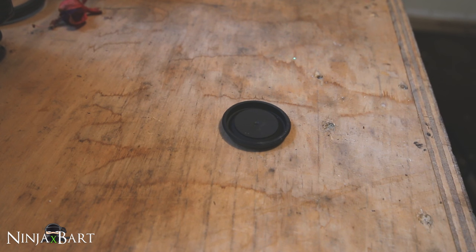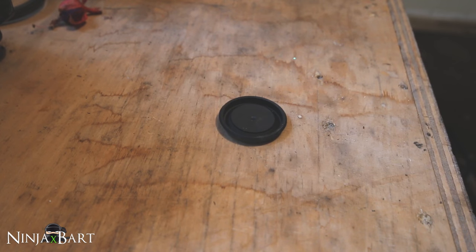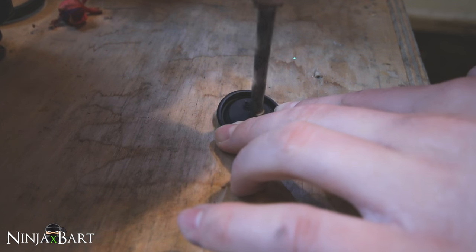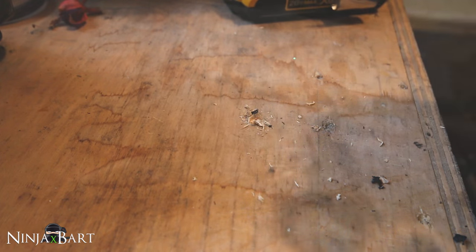All the instructions I've seen online for how to do this don't explain anything other than to take this piece out and then run the wiring up. But as you saw, that's a bare piece of metal exposed around that hole and that could potentially cut or fray the wiring. I know there's a protective sleeve around the two wires, but the one yellow wire used for the signal for the brake light itself isn't protected in any way. So what I'm going to do is drill a small hole in this so I can put this grommet back in place and then run the wires through this hole.